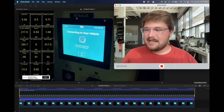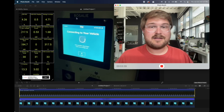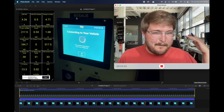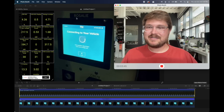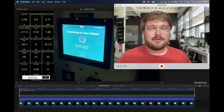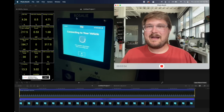Okay, so that's kind of the topic, and maybe I'll make a whole dedicated video on that, but I just want you to be aware going into this that to get big speeds on F-150 Lightning, you need big current chargers. That means 500 amp capable chargers to reach your peak speeds. The truck I've seen request about 470 amps peak, which is an enormous amount of energy.